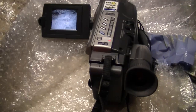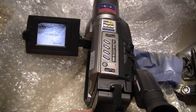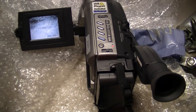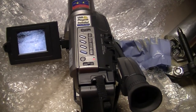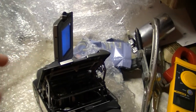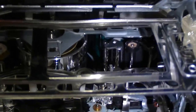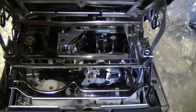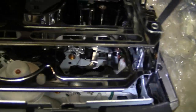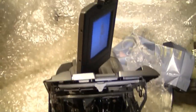I just had a problem here. The camcorder displayed an error message saying that it was in safeguard mode, and when I pulled the tape out it had actually eaten part of the tape. So I'm going to have to try this again and see if that happens again. It keeps eating the tape and it says it needs a head cleaning, so hopefully that solves the issue. A lot of people were saying online that you should use a cleaning tape when stuff like this happens. I don't see anything broken in there, so that's disappointing — I really wanted to use this today, but we'll get it fixed hopefully.